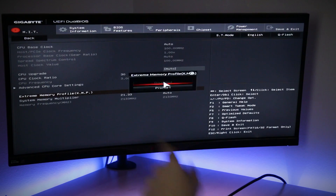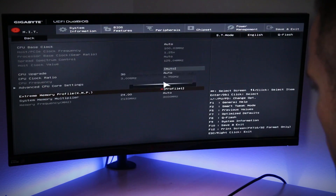The first method we're going to look at today is the XMP profile. This is actually on your memory — by turning on the XMP profile, the memory is going to ramp itself up. It's going to overclock itself, as well as usually putting a mild overclock on the CPU as well. The reason why this tends to happen is it modifies a lot of the B-clock settings on your motherboard. Something you need to be aware of is it's going to vary by manufacturer of memory, and it's also going to depend on the XMP profile of the memory, as well as the CPU and motherboard chipset that you're using.